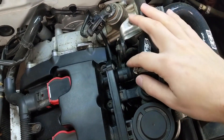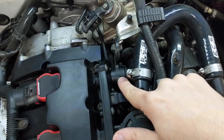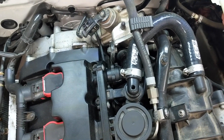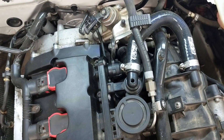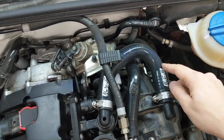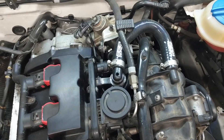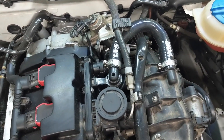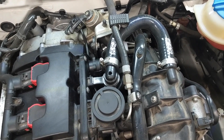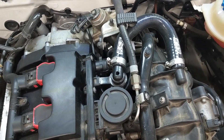The reason I decided to do this is because I actually broke the bottom half of the top clip on the OE PCV hose, and I want to make sure I don't have a leak. The silicone construction should be more resilient to the temperature and contaminants present in the engine bay, plus it'll match my upper PCV hose. Just know that replacing either of these hoses will not improve or fix PCV-related carbon buildup problems — this is strictly to slightly improve the OE system and add some style points.